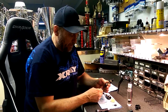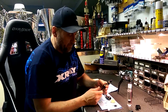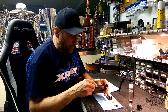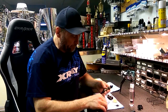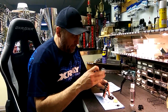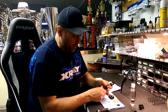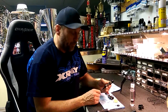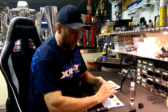Now you can see the rebound is a little bit better and the draw up is a little bit less. I'll pump it — it doesn't really change anything because there's actually no air in the oil; the air pocket is only in the cap. I'm going to do this even more, drawing it way down to create an even bigger air pocket. I can adjust the air volume in that cap — see, now there's even more rebound on its own. This will be a little bit more lively setup, a little bit more reactive, and very little draw back up because that air pocket is slightly larger.